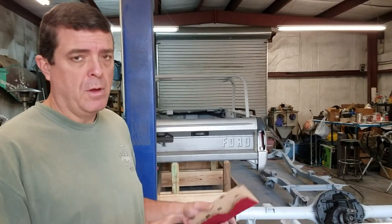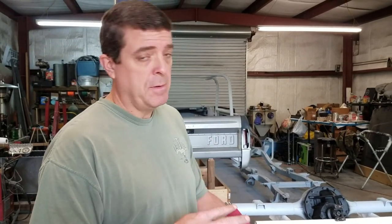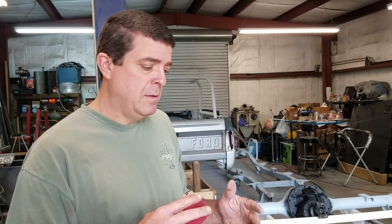By covering up those pits, I'm not hiding anything. It's been sandblasted, everything was brought back to bare metal, then we primed it with metal lock. Now we're about to start sanding the metal lock. I just have some 80 grit — we're gonna go pretty coarse to start — and we're gonna sand down until we start seeing the metal shine through, let that metal lock act as a filler. Then we'll go over the whole rear end that way and prime it with 2K, prime it real heavy.